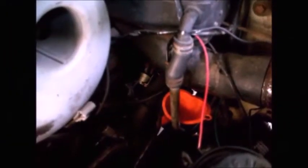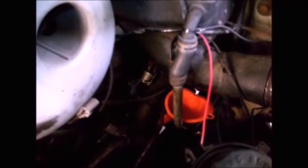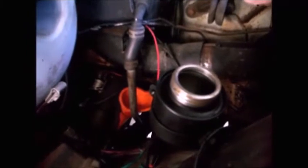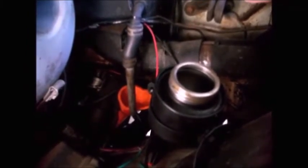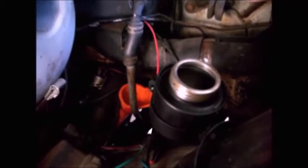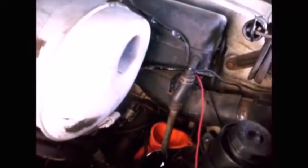I haven't tested it yet — I just installed it. But while I'm installing it, I'm going to go ahead and rig up a remote reservoir. I found this on eBay — I just did a search for 'remote brake fluid reservoir.' I like this one because it's metal and it looks vintage and it looks like it belongs in a '55. I think the ad said it came out of a '63 Sunbeam Alpine. It's just a container that's vented — there's a little pinhole at the top, a little pinhole right there. That's your vent for air, which every master cylinder has.